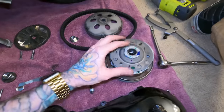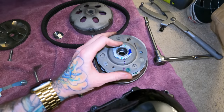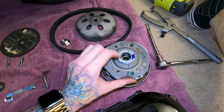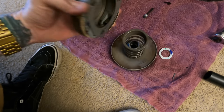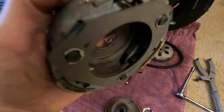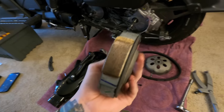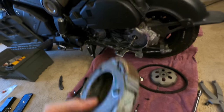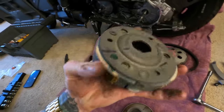Next step is taking this apart. It is loaded by that contra spring, so the way I understand it is you can just kind of step on it to keep pressure on it and then blast this thing off with a 39 millimeter socket on the impact. That was easy. You can see how it kind of came apart with that spring there. So far I don't see any of the springs out of place, so I'm still not sure why it's been acting like that. Anybody who knows more than I do, maybe comment and let me know whether or not the clutch pads look like they're glazed.